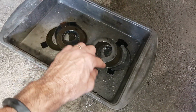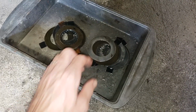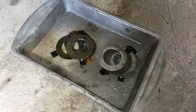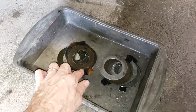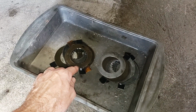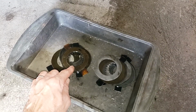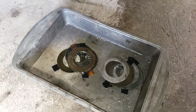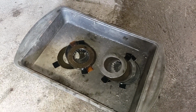And these clutches, which that's the organic material, and this is the steel shim, they wear down. There's plenty of videos on YouTube. There's hundreds, so I didn't do one on that. But I replaced these original equipment clutch discs with carbon ones, which is the new thing. They grip better, they hold better, they last longer, all that stuff. So, like I said, if you're interested in seeing a video on that, there's a lot of great ones out there.